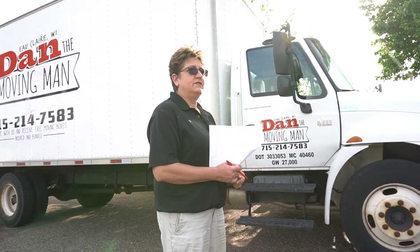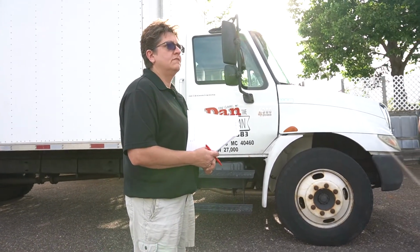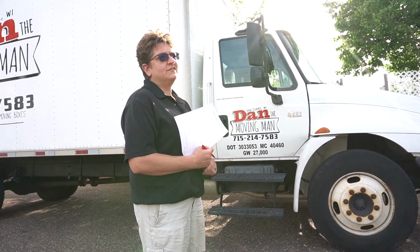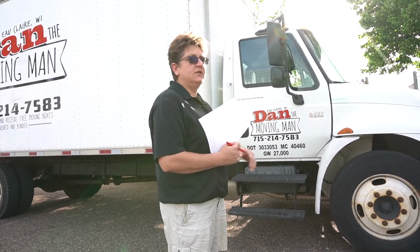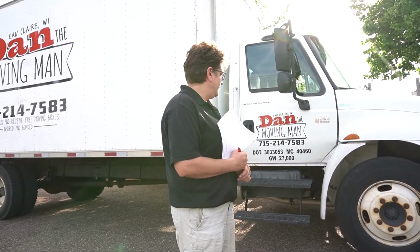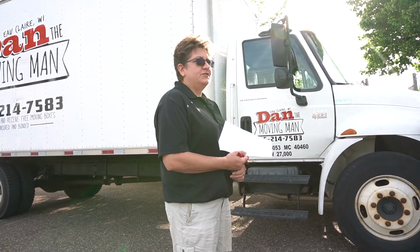How long should your average truck inspection, like say we come in the morning, time-wise, how long do you think we should spend doing that? Typically it'll be about 15 minutes. 15 minutes, give or take. Because you just want to do a really good once-over on it. Look at everything. You're just looking in the hood, checking things out, making sure you don't notice anything that's pretty severe. Checking the tires and everything. Like everything here that's listed, and making sure it's road ready.